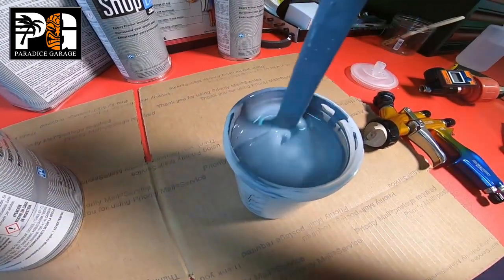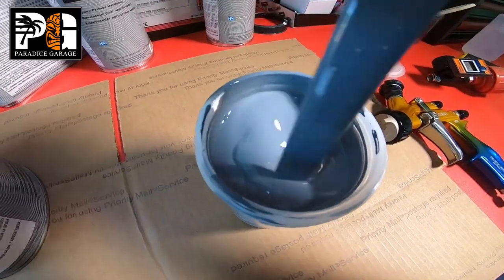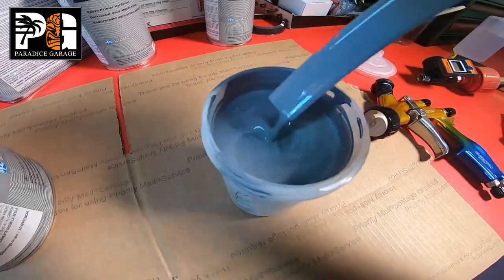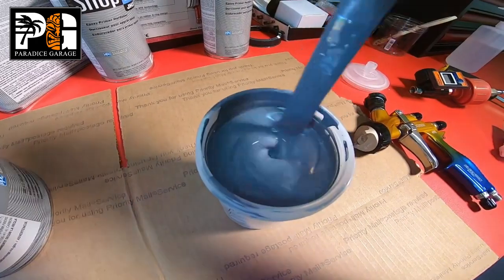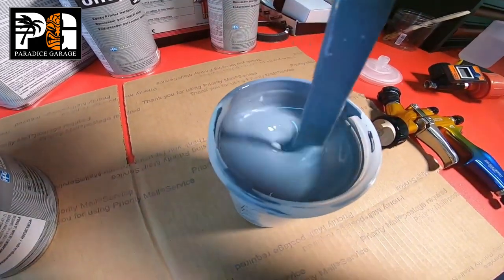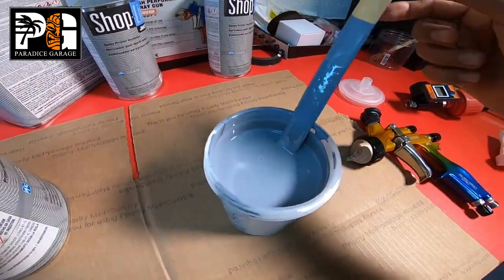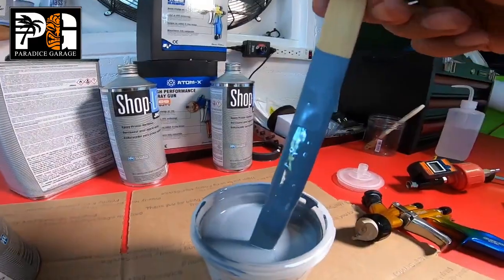Here, we're not doing too much. We're just spraying a couple metal pieces here, some aluminum hanging out of our rims, and we just want to put some epoxy primer on it. Then we're gonna put some 2K filler primer on that right after we do this and let it set and dry. So this is pretty much mixed up, and I wanna show you a trick here